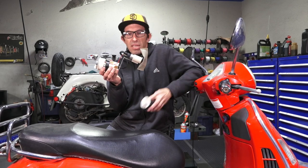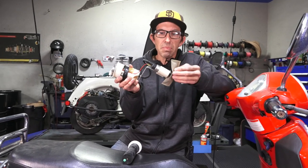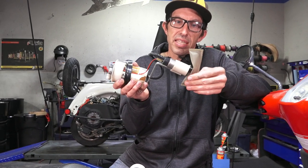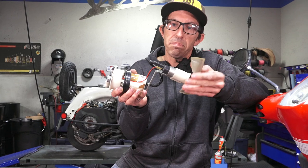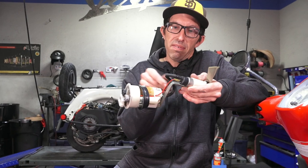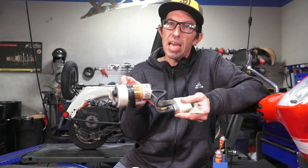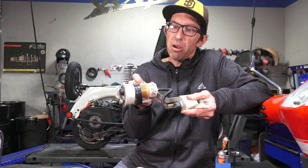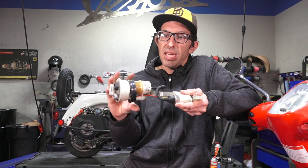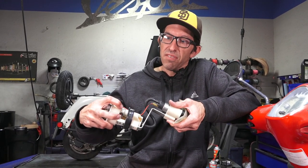A quick overview of the anatomy of a fuel pump assembly. This is the filter sock — it catches the big particles. This is the electric pump itself, an electric motor submerged into the tank. There's a nylon hose and this is the fuel filter, designed to last the life of the scooter. It is available as a spare part but very difficult to change. It's not technically designed to be reused. The last component is the fuel pressure regulator.